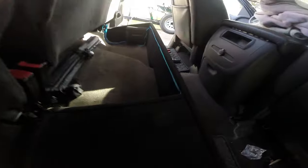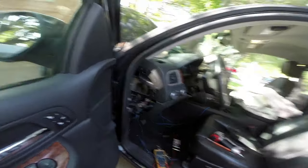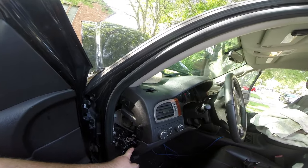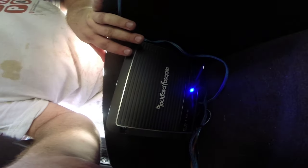Here's the final subwoofer wiring. The wire is run over there, all wires are tucked. Even though I find it a bit bizarre, none of these fuses are on switched power — they're all either on the battery or not on the battery. We have it plugged in and it's getting 12 volts. Power light is on, so we know we are getting power out of the amplifier.